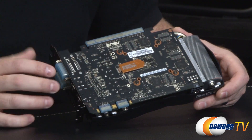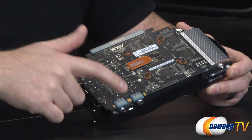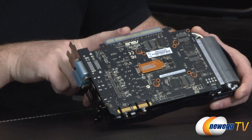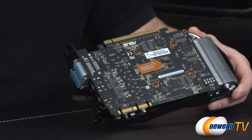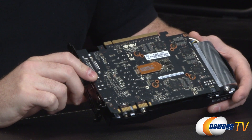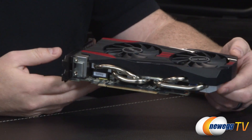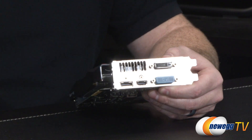The card has a black PCB keeping with the black and red color scheme. You can see the GDDR5 RAM modules for the two gigabytes of memory, and a couple of SLI fingers — this card supports two, three, and four-way SLI. It uses PCI Express Gen 3, which provides about double the bandwidth of Gen 2, though video cards don't saturate that bandwidth. If you're on an older Gen 2 or 2.1 platform, you'll still get near-maximum performance — perhaps a percentage point or two slower — as it is fully backwards compatible.